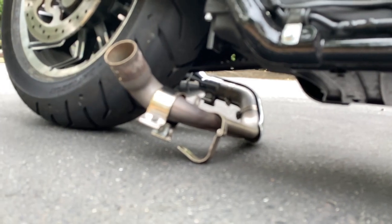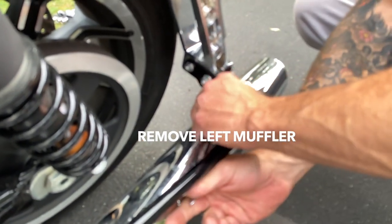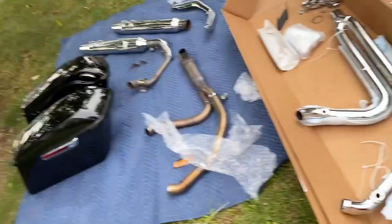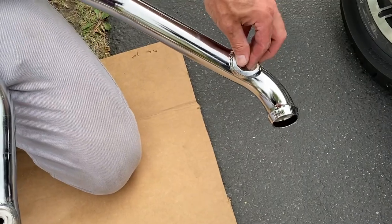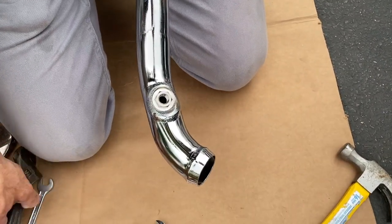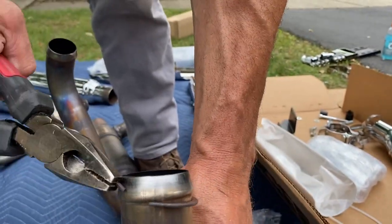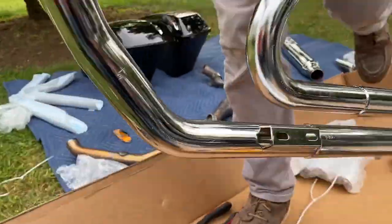All the old pipe is off — all the material, all the metal, everything is off. It's time for the new one to be mounted. Let's prep this one. Stock O2 sensors are smaller — Vance and Hines actually includes reducers in the kit. We need to use the headers from before, they don't come with the new pipe. So take the exhaust gasket and the headers and put them on the new pipe. Gaskets are on, headers are on, and on it goes — this is where the magic happens.